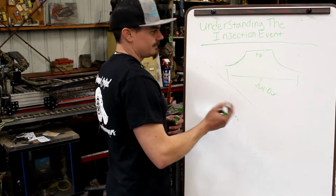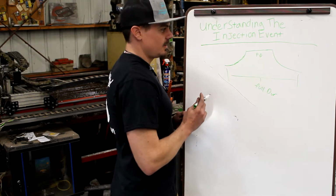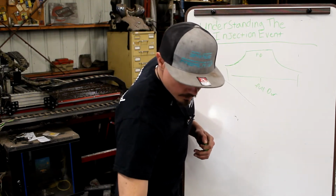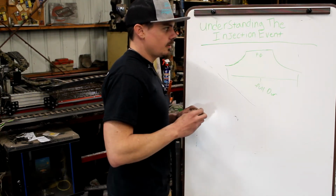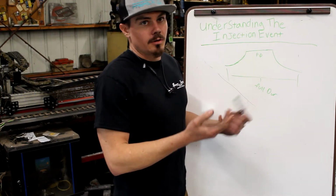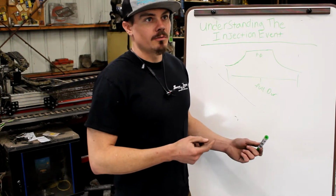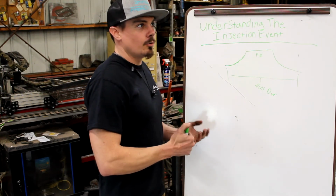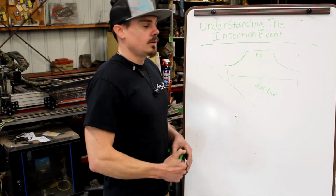Full dur. What happens, we've done this on the dyno, and we have all the dyno graphs to back it up. We've done it with a VP power truck. Now we know that VP pumps get a lot of trash talk, basically because way long ago, people were modifying them without putting fuel pressure gauges on them, and they would run the things out of fuel pressure. And fuel pressure is not what killed them, it's fuel volume to keep them cool.